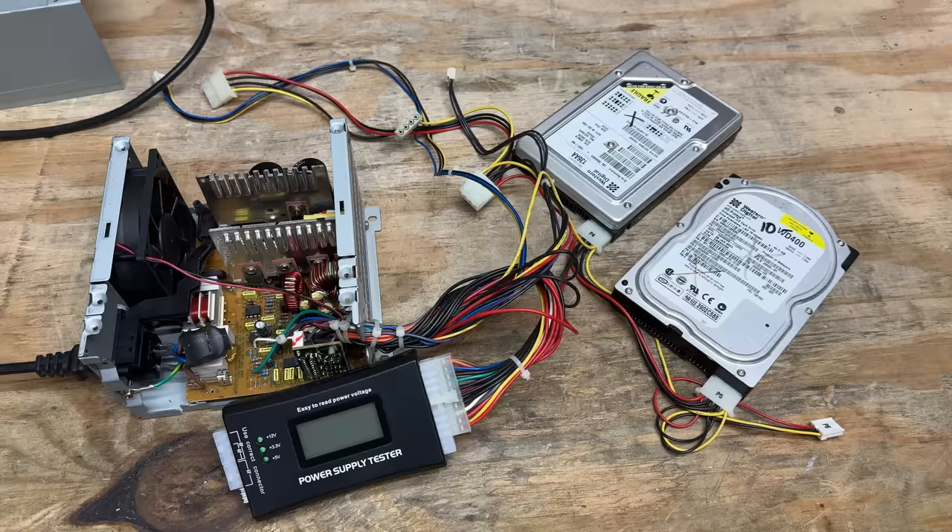Just in case you're also working on this type of drive, I want to show the method for releasing the disc tray - it's not obvious at all. There's a release tab on each side, and you just push them forward towards the back of the drive, then slide the disc tray out. It took me way too long to figure that out. That belt is not quite perished but it is out of round, and none of my replacements are the correct size, so I'm going to try boiling it to return it to its original shape.